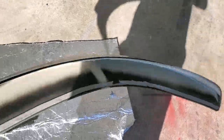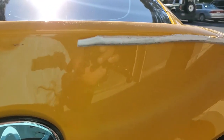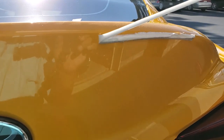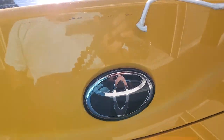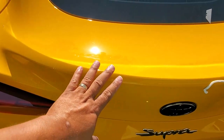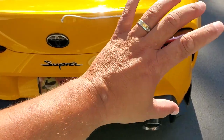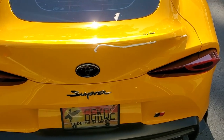I was pretty successful. The front part came off real easy — I don't think it was on very good. But that back part was really on tight. I think I successfully got it off without pulling any paint up, surprisingly. I don't see any rub marks. This leftover tape I'm going to just pull and roll — see how it's coming off nice and easy. Then I'm going to wash the back end, use some safety body solvent to remove any glue residue, do a clay bar, and wax the rear hatch. After that's cleaned up, I'll show you the new mounts for the new wing.